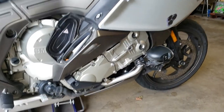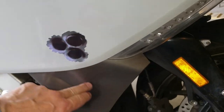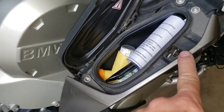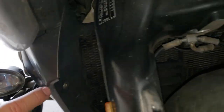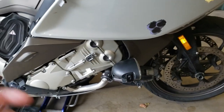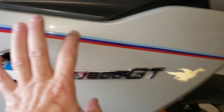For those who haven't watched my previous videos, the lower housing has to come off first before you can get to the upper one, because there's a bolt right under here that we can't see. We're going to take these screws out here and then come around to the inside — there's one here, one down below, and then two underneath. That'll let us get the bottom part of the fairing off and expose the mounting screws that'll let us take the top one off.